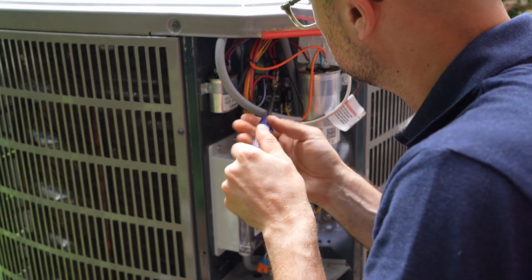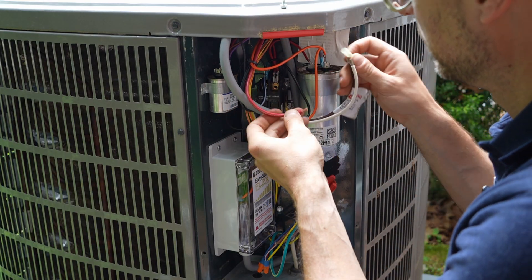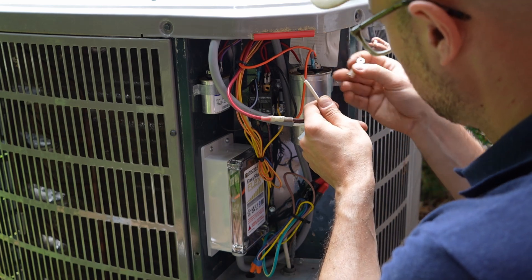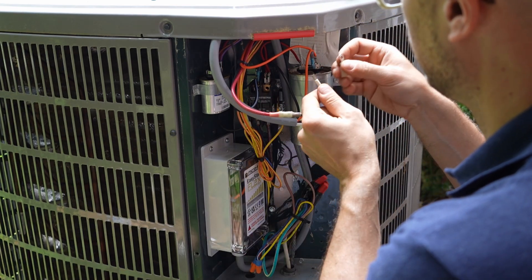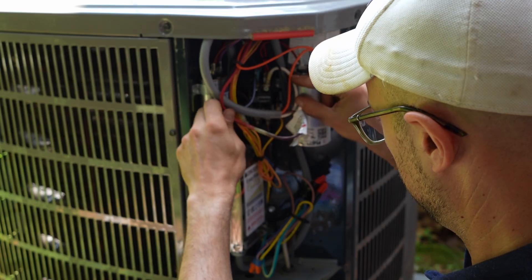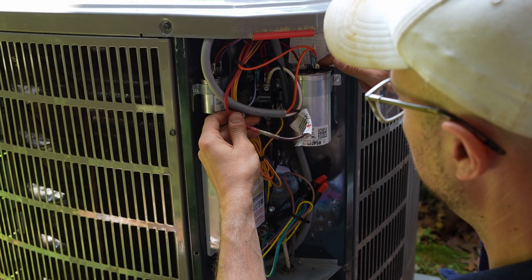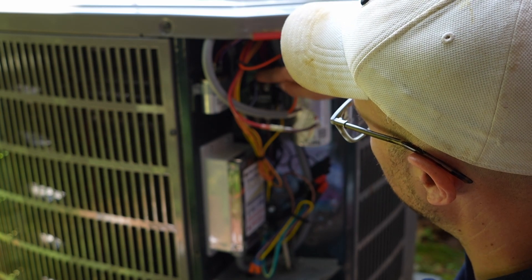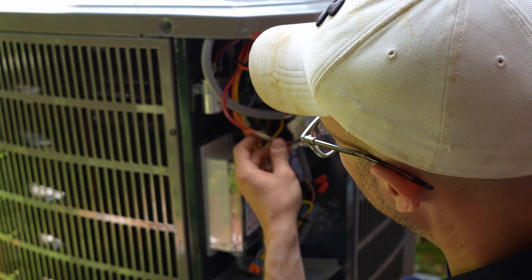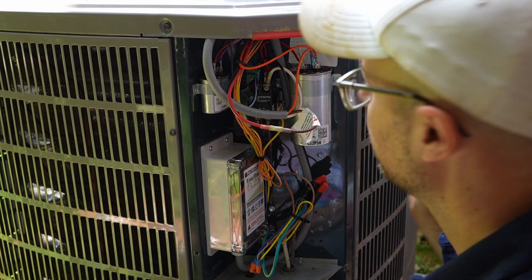I'm going to use a butt connector for joining these together. And then finally we need a ring connector for the white wire to go back onto that terminal on the relay. So just to review the wiring: we've got the orange wire going to the Herm terminal of the capacitor, the black wire going to the common terminal on the relay, the brown wire spliced into the run wire of the compressor, and then instead of the run wire going to the relay, we've now got the white wire from the soft start unit. The wiring is complete.